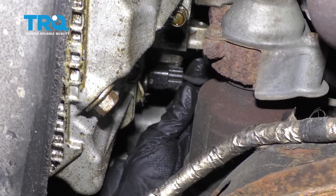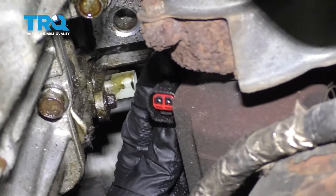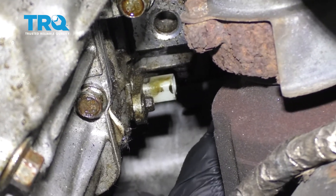On the outer aspect, right where my thumb is, there's a little tab. I'm gonna go ahead and squeeze on that tab for the electrical connector, remove it, and then of course you're gonna inspect it. If you see any funny colors, it's corrosion and it needs to be dealt with. This looks great, so I'll set it aside.